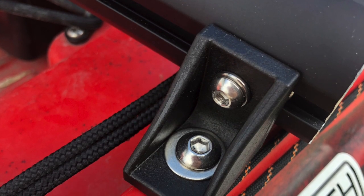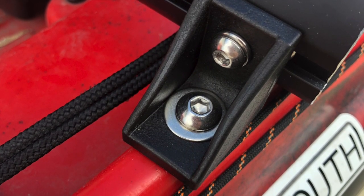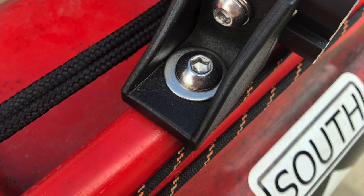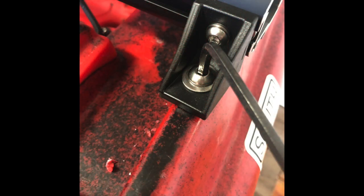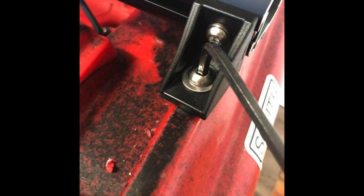Once all holes are drilled, reset the knuckle assembly and drop each 5/16 bolt with a flat washer through the open holes. Reach through the hatch located behind the seat with one arm, and hold the tapped backing bar up to the 5/16 bolt. Using your free arm, turn the respective bolt until the threads catch. Make a few more turns to secure, then repeat for the second bolt. It helps to alternate bolts a few turns at a time to keep the assembly from binding up. Do not tighten down hard at this point.